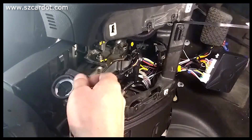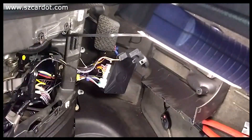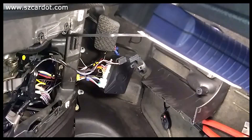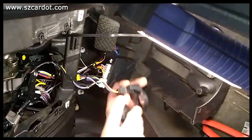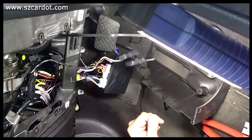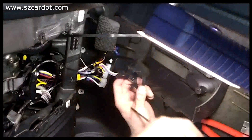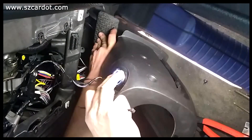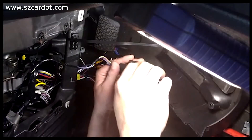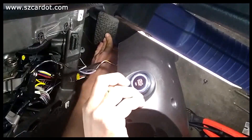If this ring is not there, it won't turn on. It comes off easy — it just has a couple of clips and you pull it off with your finger like that. The way I'm going to show you is so you don't have to use an immobilizer transponder bypass. All you do is put the key right here and tie it with a strap. The car will not turn on if the key is not in the RFID loop.